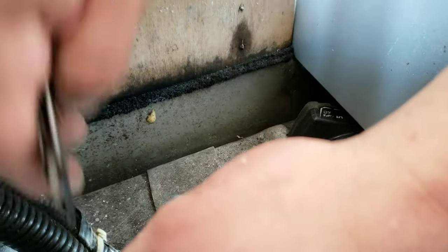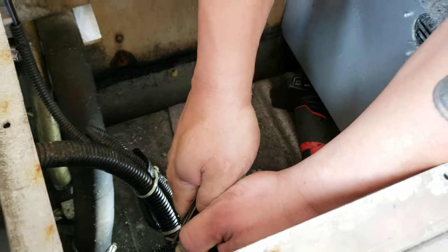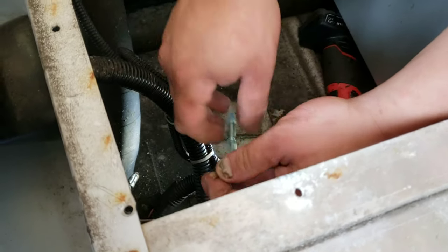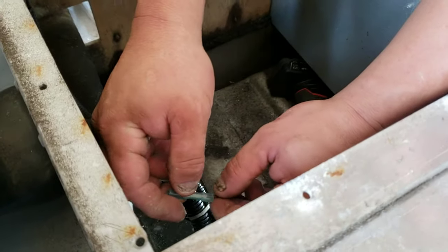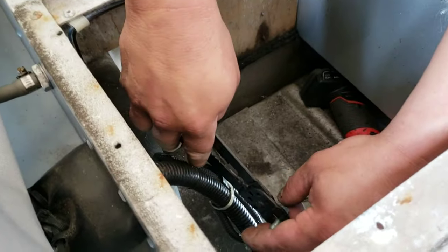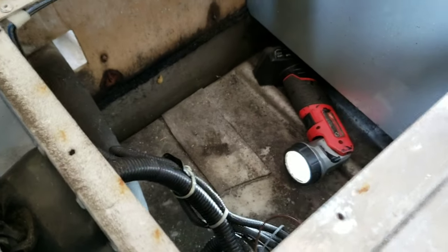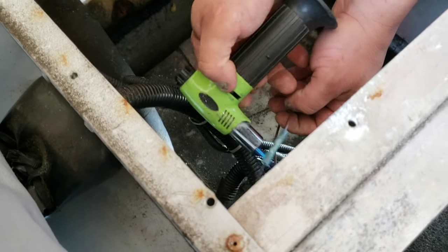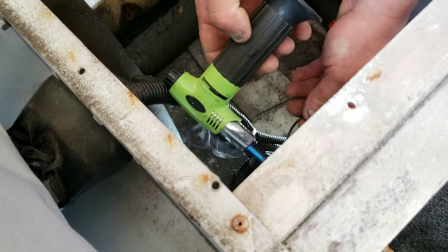Yeah, it's a little wasteful wire doing like I do. Cut it, add extra wire, and then throw out the extra. But I've short spaced myself before, where I've made a wire harness and had it just a little short, and then I gotta put another connector just to lengthen it. The less connections you have, the less likelihood of a bad connection or a failed connection later on due to corrosion. If you ever worked on semi-truck trailers through the winter here in Wisconsin, you'll find out that the baddest wire harnesses ever don't take long before they go bad. So you try to minimize your connections.